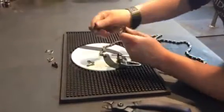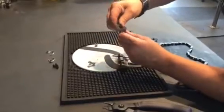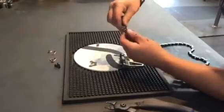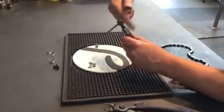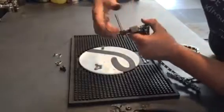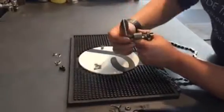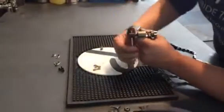I'm going to take that off so I'm just left with the pin and the two plates. Pop that in like that — it should snap in — and then I'm just going to push that pivot, that rivet, back in; just drive it back in. Now it's going to be quite tight on the link.